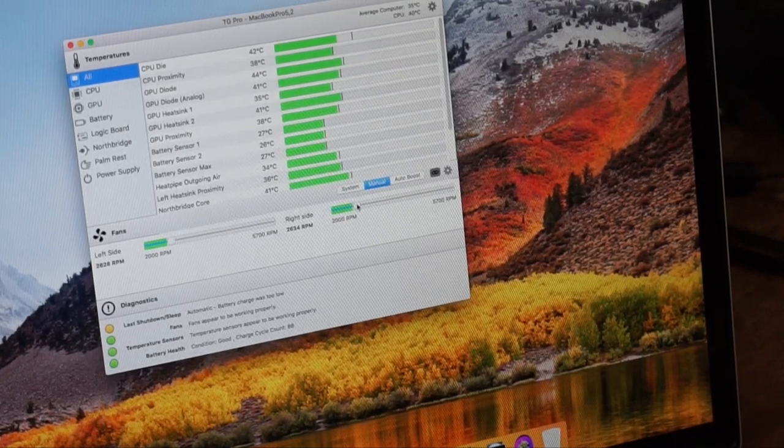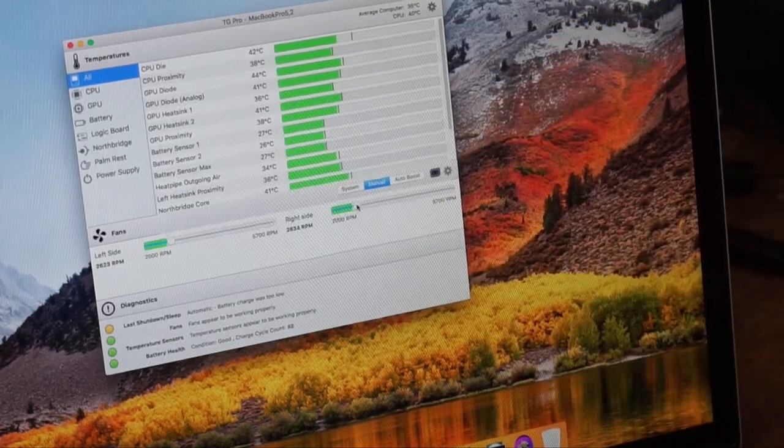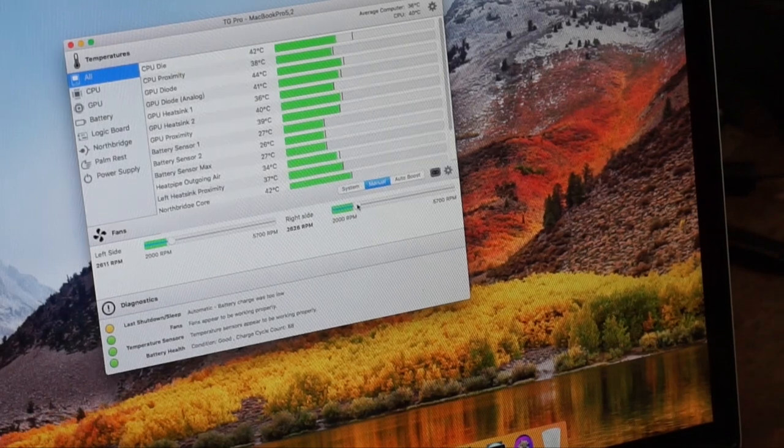So, it's actually not hot at the moment. I've actually used this computer where I've had these temperatures spike up to 100C already, which is 212 Fahrenheit, which is borderline burning up. So, I was told by my buddy Jay that this is his old computer, so he told me that it's probably due for thermal repasting. However, this computer is known for running hot. Core 2 Duos are not exactly known for their cool running.